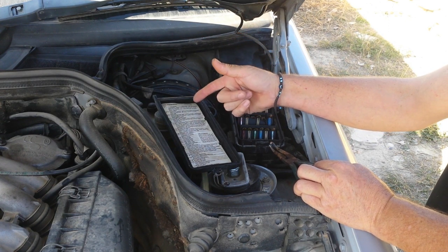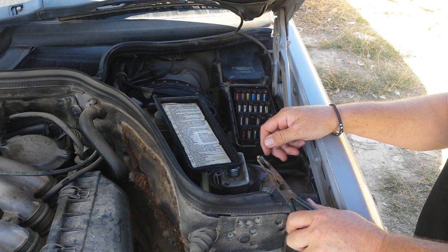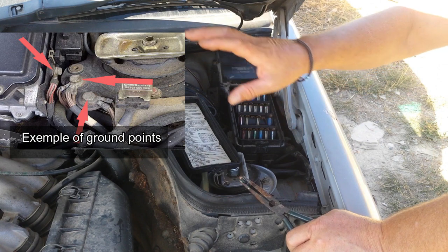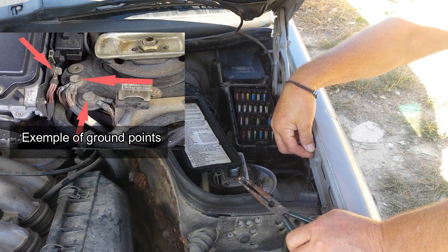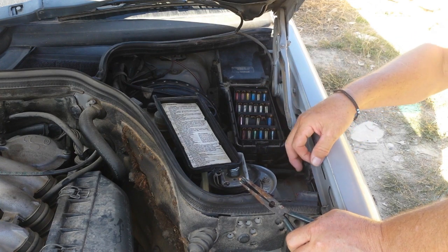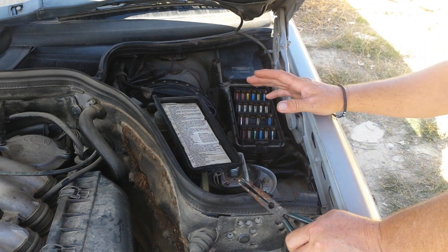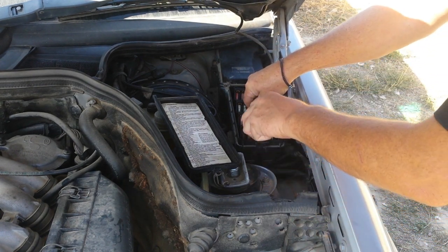In that case open the boot and check all the cables that go there. There are a lot of ground connections on the car, a bit everywhere — so around the window in the boot you will see a lot of bolts with cables. Unscrew them, clean them nicely, place them back together. Check all the cables in that area, make sure no two are touching together, because obviously that will create a problem as well. If you check all that, normally you will fix your problem.